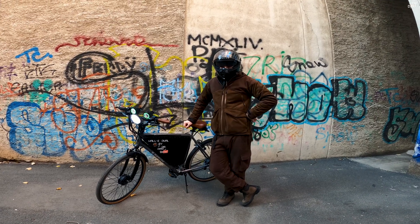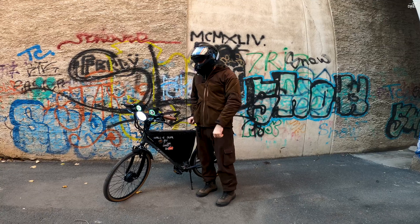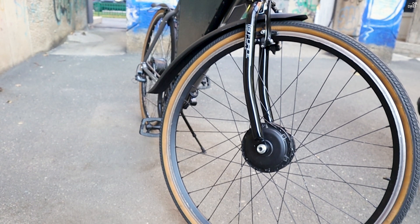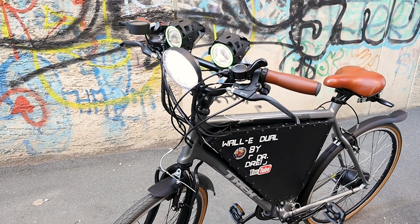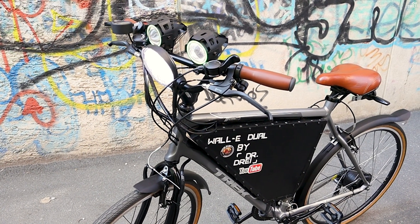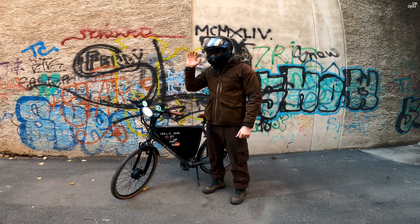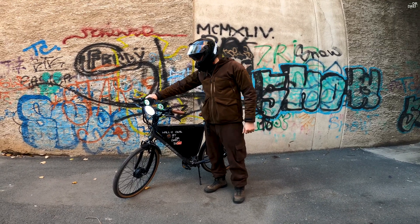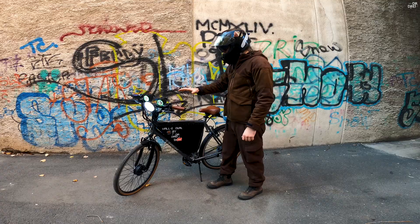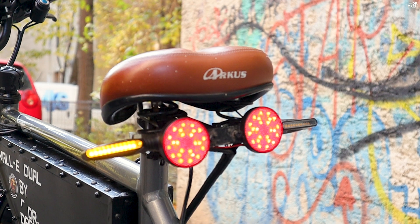The final result is not done! I discovered a problem while test-riding — the battery drains very quickly. Some cells need to be repaired or are not good, which is normal since I started this project many months ago and the battery has been sitting that whole time. Anyway, I've made some modifications: I managed to repair a 10A step-down, installed a heatsink on it, installed the turn signals, and added cell protection, since it seems very important that the cells are protected.